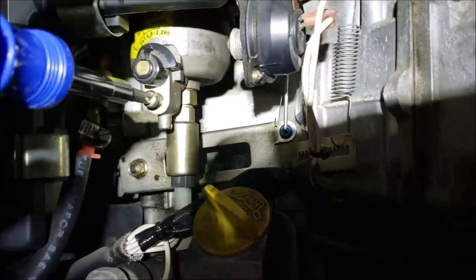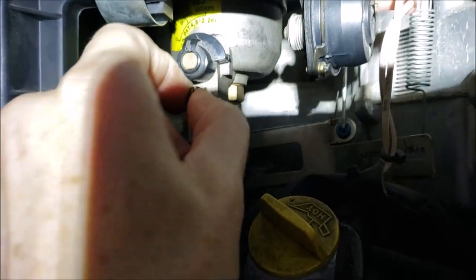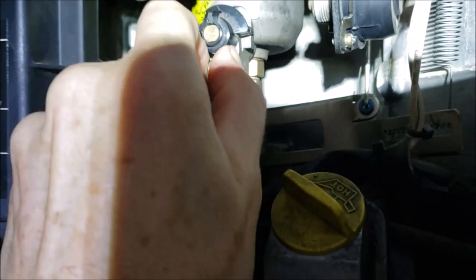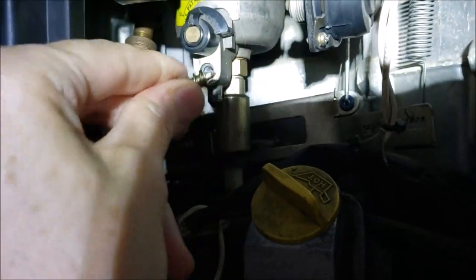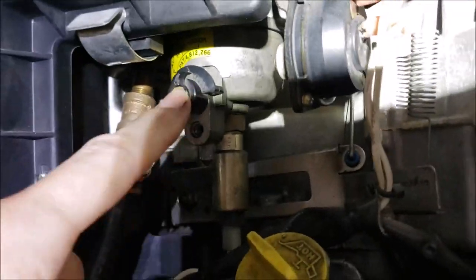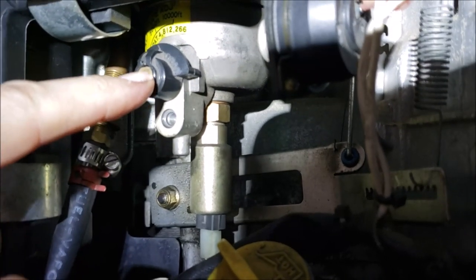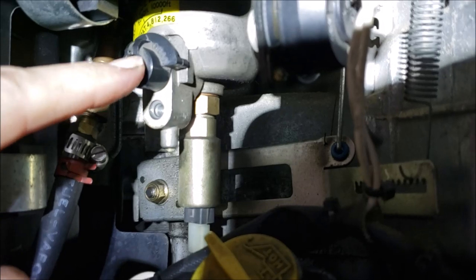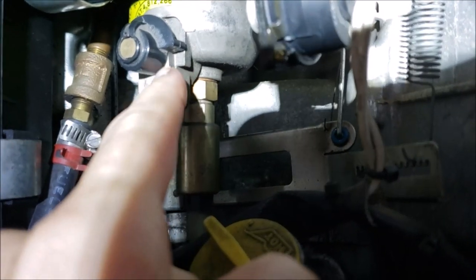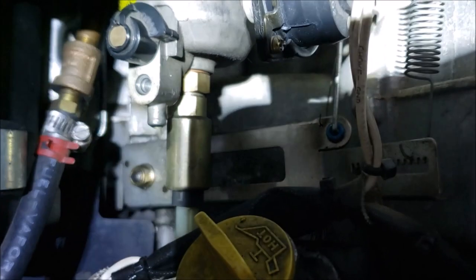So I'm going to try to completely remove this screw out. Because it gets tricky — this is a small needle screw, that's the brass you see here. I've got to figure out a way to remove this plastic knob off while it's mounted to the carburetor and not break off that screw. It could break off if you don't apply even pressure to remove it straight off. If you try applying pressure on one side it could push sideways enough to break off the stem, because it's kind of a small threaded screw once it gets in there.